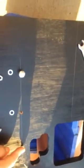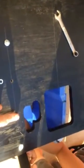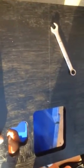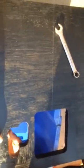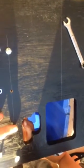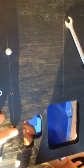See it, or need another one? These cutouts are for the transmission and the emergency brake. This particular 1928 Roadster pickup doesn't have the standard 3-speed manual. It has the AA heavy-duty truck transmission. It's a 4-speed manual. It has a granny low. They first came out at the very end of 1929, so this was a factory retrofit.